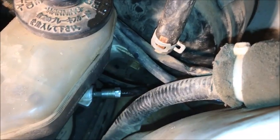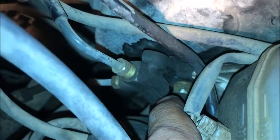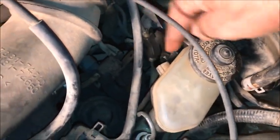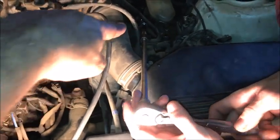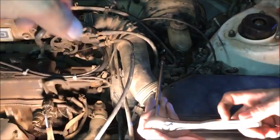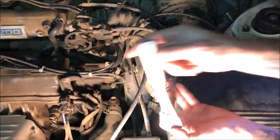Both lines are off. The first 12mm nut is right there, and for the second 12mm you'll need to move this bracket out of the way. There's also a clip for the brake light switch — unclip that and pull it off. We're using an extension with a swivel on the end to get way up in there, which makes it much easier without having to move the air breather, lines, and hoses.